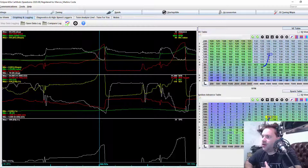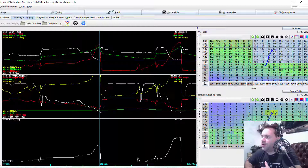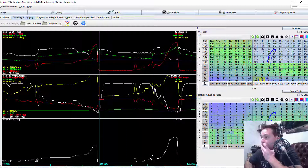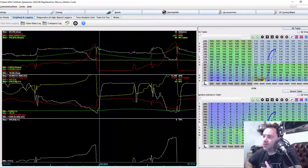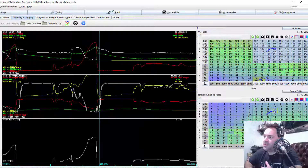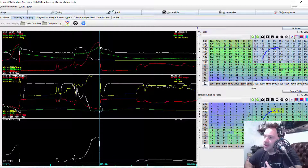You see there — 140 kPa. My AFR was 10.8 and it was supposed to be 11.1. Pretty good, right? But then I took my foot off and it went all the way down. So this is what I can understand using this log view.